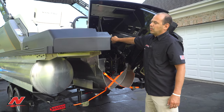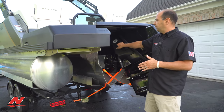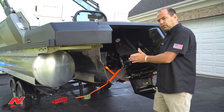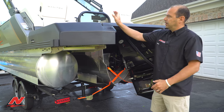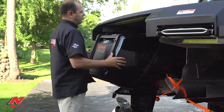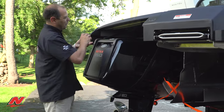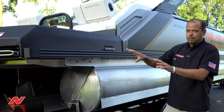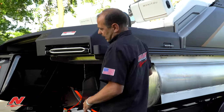I should mention that this motor will not trim down if it's turned too far to the left or too far to the right. So if you're trying to trim your motor down and you're having a hard time, or it just trims down in small little increments, bring your motor more towards the center and it will trim down. There's a sensor in there so when you're trimming up it won't hit on the sides. This whole unit basically is sealed and it's its own ecosystem. There's a literally an intake tube that goes up the center of the boat — the air intake for that motor comes in from the inside of the boat, through a hose and down into here.